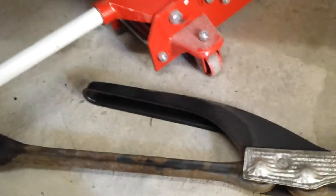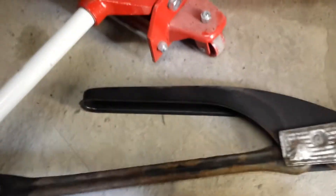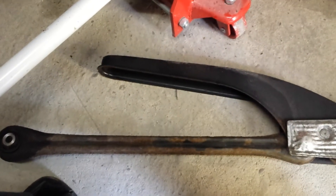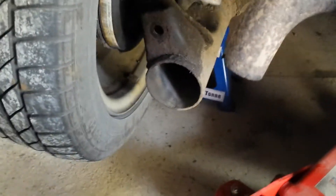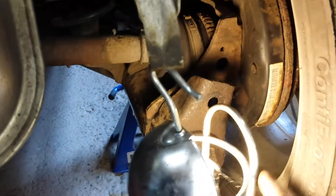The cross arm is something you have to take out in order to lower the engine from one side. This is based on notes I've learned from the internet — this is not the proper smart method, as the proper one would require special bolts. This arm connects with a bolt here and a bolt at the top just behind there. Once you take that out, this side is released and the tire actually falls down a little bit. The same thing on the other side — one bolt in there, one bolt to the top, mounting at the back of the wheel.